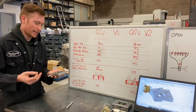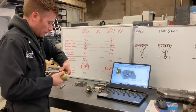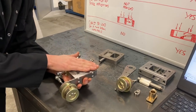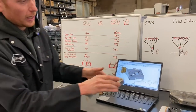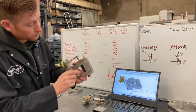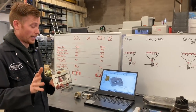Obviously designs have to develop, have to advance. So this is it — this is the new version. That's it in split-down form, but this is it in its assembled form. As you can see straight away, the division doesn't come all the way to the top. That means you can now use this valve on a twin scroll manifold, which was impossible before. If you used the old one on a twin scroll manifold, it would have completely blocked off one exhaust port to three cylinders. Whereas this new one has been designed with a recess under there, so that when it's bolted up, you've still got almost a full exhaust port's width for that gas to get through — which at low gas speeds works perfectly fine. So you can use this on a twin scroll manifold, which is quite an exciting new thing.